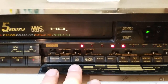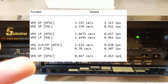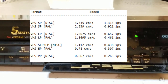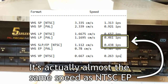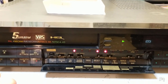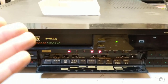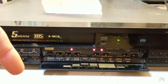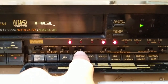I'm going to put up a little chart of VHS tape speeds. LP for PAL sits between LP and EP for NTSC, so you're getting a lot of information on the tape already — a ton of information — because you're doing 50 fields per second instead of 60. The swipes of the head drum are fewer, so on PAL you can fit a lot more on the same amount of tape.